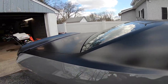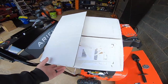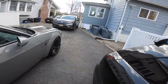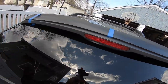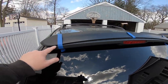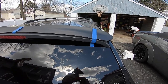So the first step — it comes in this teeny, itty-bitty little box. Yes, a full-size back window spoiler comes in this little box, all curled up. When you take it out, it doesn't hold its shape. When I got the box, I was in a rush, so I just opened it up and laid it flat in the back of the Magnum, as flat as I could. When I came home that night, it was perfectly straight with no creases. Right now the Magnum roof is nice and hot, so I need to create a curve — an arc — so it goes around the back window. I've taped it here, pulling it back to create that arc, and then pulling it back down the other way so it just sits in the sun and bakes into that position.